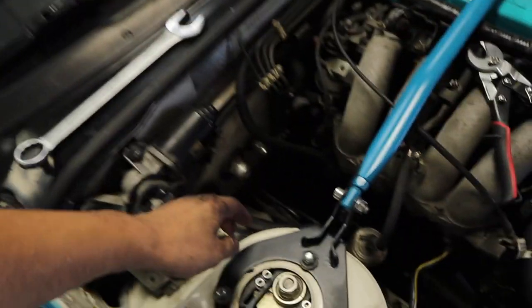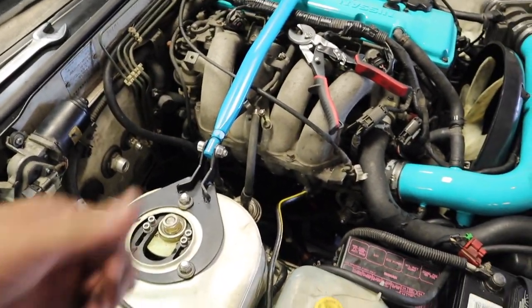All right, so I finally managed to get both of the lines on, the inlet and the outlet. But here's the catch. That one's good, but this one down there is going straight through my motor mount bracket. It's going through the bottom and then coming out that way. I hope that's okay. I think it'll be fine. But usually when somebody installs an oil cooler, they also pick up an oil relocation kit. So I should have done that and had my oil filter right here. But this will be okay for now.